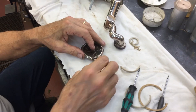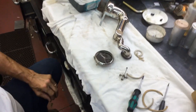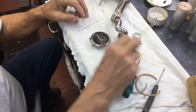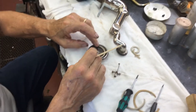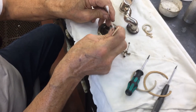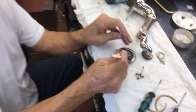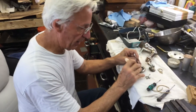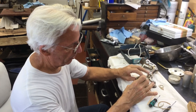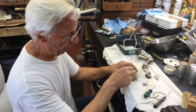After you get this put in, then you wax it on both sides. Then you take a blunt object like this round piece of wood and a Q-tip, and you set your new gasket material in. Then you push down on the mica and push it in all the way around — it's a little bit tricky, but you can work it out. You don't want to mar the mica. And then after you do all that and you've got all this together, then you're going to build two little gaskets in here.